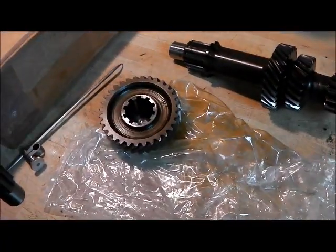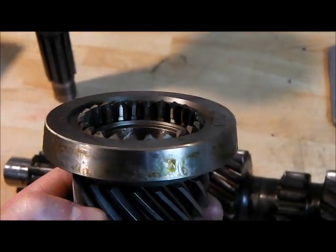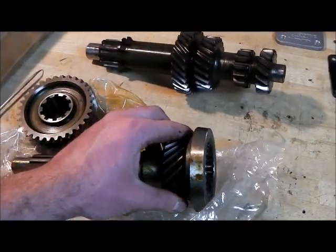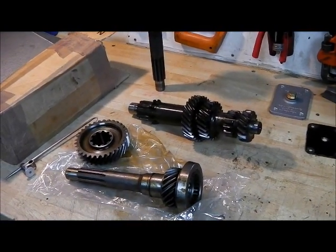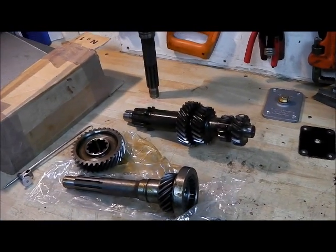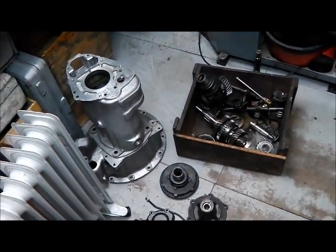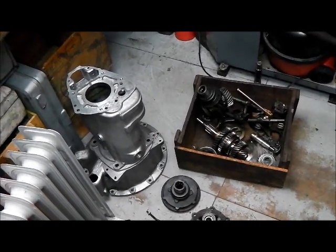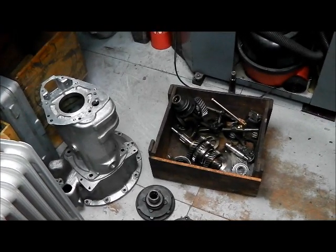This is the primary pinion that came out - it's in a pretty bad way, but you can see that the teeth for the synchroniser have the little cutout. This is a new primary gear set - you should always get them as a pair. I picked this up on eBay new old stock for a third of the price of a new one, so it's worth just searching part numbers while you're doing your gearbox build. So that's how I've identified this gearbox as definitely a suffix D, and I know that I can order parts safe in the knowledge I'm not going to be wasting my money. The next video we're going to have a look at the front output shaft and changing that bronze bush - hope the video has been of interest and thank you for watching.